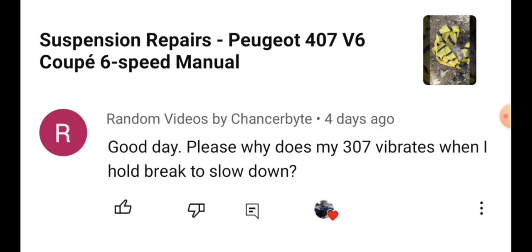So when they get hot and you press the brake pad to grip on them, they will be slipping. You know, the pads will slip on the disc when hot. That is for the low quality brake disc, no matter how good or new they are. So in other words, the brake disc can do that. Then the brake pad as well. If the brake pad is not good, yeah, it can do that. But mostly it is the brake disc.